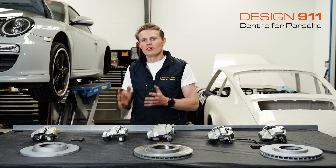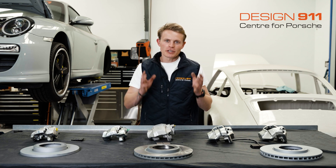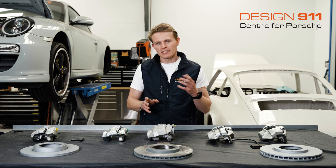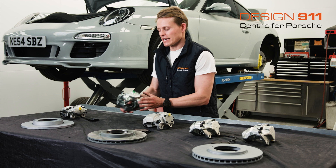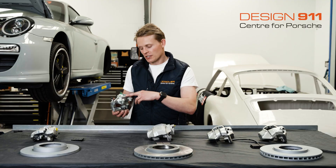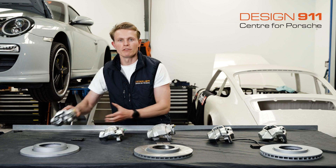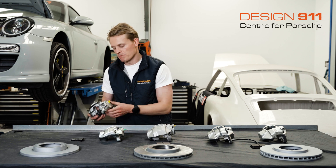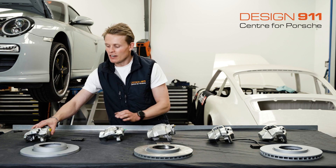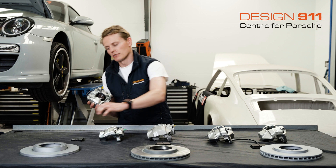So that was a whistle-stop tour of Porsche 911 brake calipers from 1965 to 1989. If you're wondering which calipers you've got or which calipers your car should have, there are a few ways to identify the caliper. These early-type cars had calipers made from cast iron with a three-inch mounting point. If it measures three inches, you've either got an M-type caliper or a very early 911 caliper. A very early caliper won't fit over a vented disc — you will only be able to use it with a solid disc.